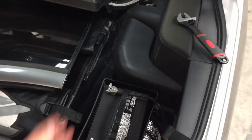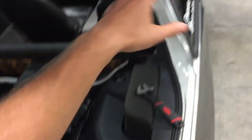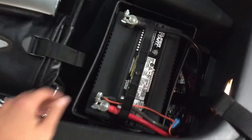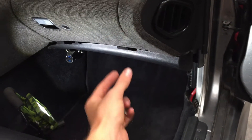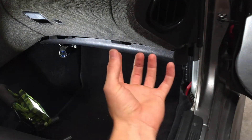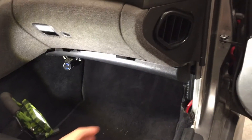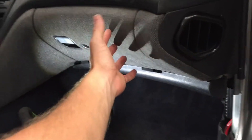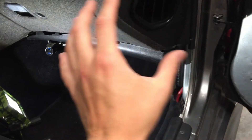Before we start digging into anything, disconnect the battery just to be safe. The last thing you need is an electrical problem to arise because you didn't disconnect the battery. So first things first, let's get this out. I'm going to try and keep the ECU in this area, but the MS3 might be able to go upside down on top with wires coming out to the side. Right now I'm going to start clearing a few things out, removing this plastic piece, maybe taking the glove box out — whatever I can do to get enough space in here. When you're cutting and stripping wires in such a crammed area it's going to be hectic, so let's start clearing this area out and pull the old ECU.